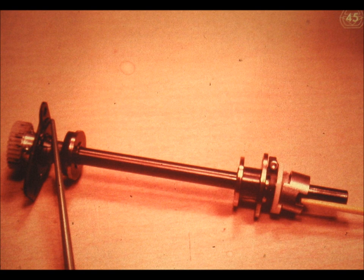Once the sleeve, the ratchet, or the disc of a clutch has stopped against the latch, the right end—or simply one end—of the clutch spring can no longer continue to rotate with the cam or the shaft. The cam or the shaft, however, will continue to rotate because of the momentum it has acquired while the clutch was closed or engaged. As the cam or shaft continues to rotate because of its momentum or inertia, the clutch spring is opened or stretched.